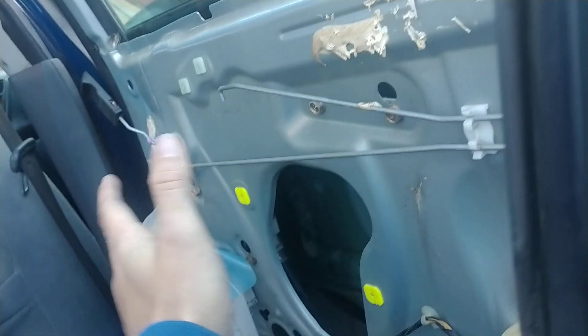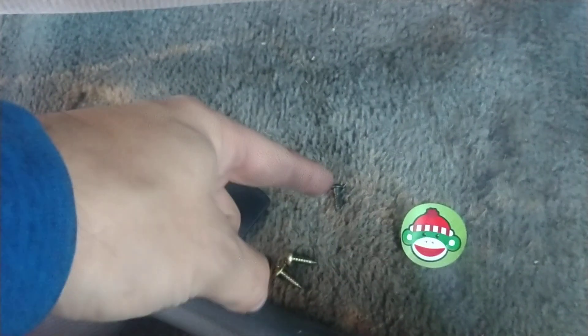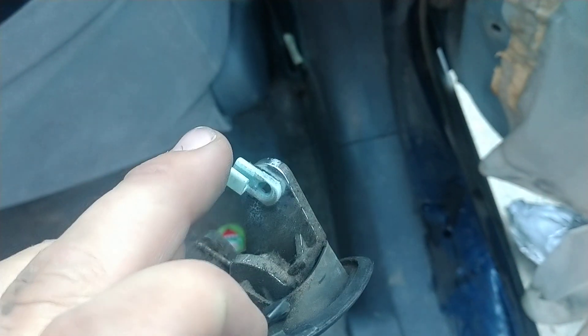Once the window is down, go in and remove the entire door panel. The door panel is affixed with two screws that hide behind the handle latch, under a little cover plate right here. It has a little tab to pick it off right at the top, and there are the two black screws. Once you take those out, the handle cover will come off. You'll find a rod hooked up to the back of the handle with a plastic clip — that just swings off. You clip it off the bar and pick it up.